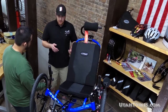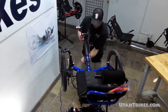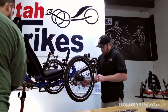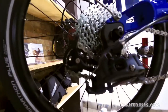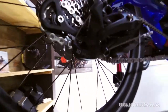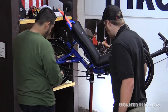Should you get your trike and the boom is a little too long for you, you're going to move that in. That will cause the chain to become essentially too long and we'll need to make an adjustment. I'm going to go ahead and adjust that boom to replicate this issue that a customer might have. It's worth noting that currently the chain is set on the two smallest rings. As I slide the boom in, you'll see the derailleur start to angle back and upwards. There is contact at the chain and the jockey wheel, and the angle of the derailleur is pointing upwards — this is an indicator that the chain is too long. We've now got slack on either side of the chain.